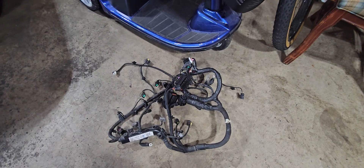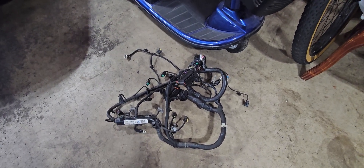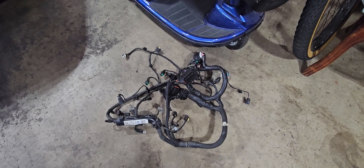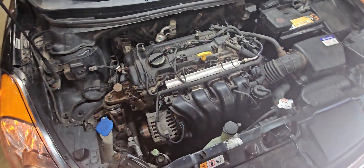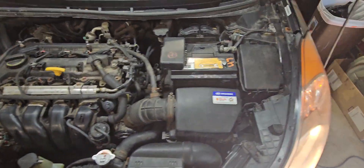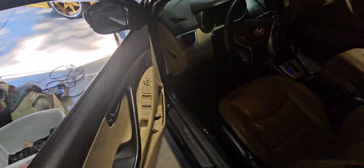You're going to need your original harness from the push-button system — put it back on the engine. What you need is an engine and a push-button harness. It's simple as that. I had to figure that out, but that's how you do it — now the thing runs. I'm saving you some problems, or if you already have this problem, that's your solution.